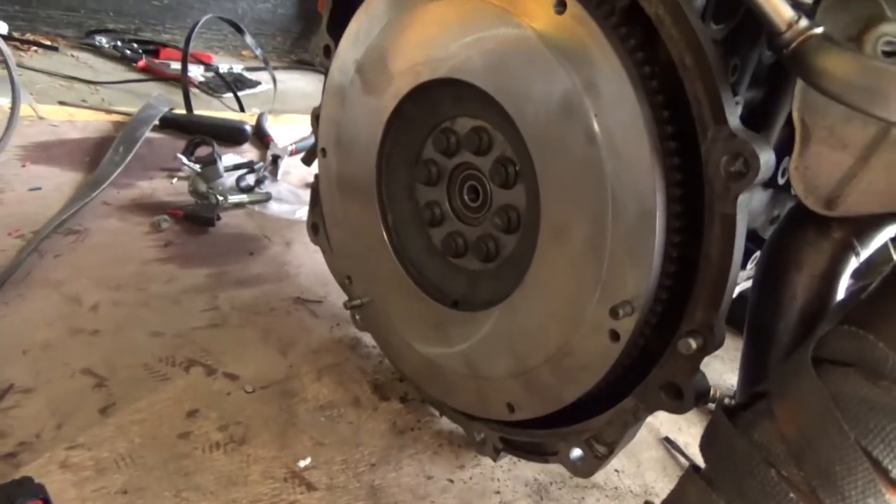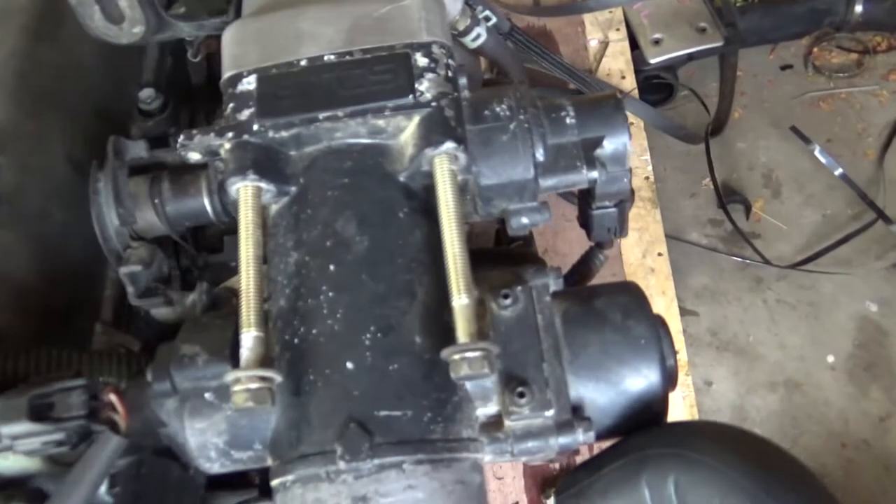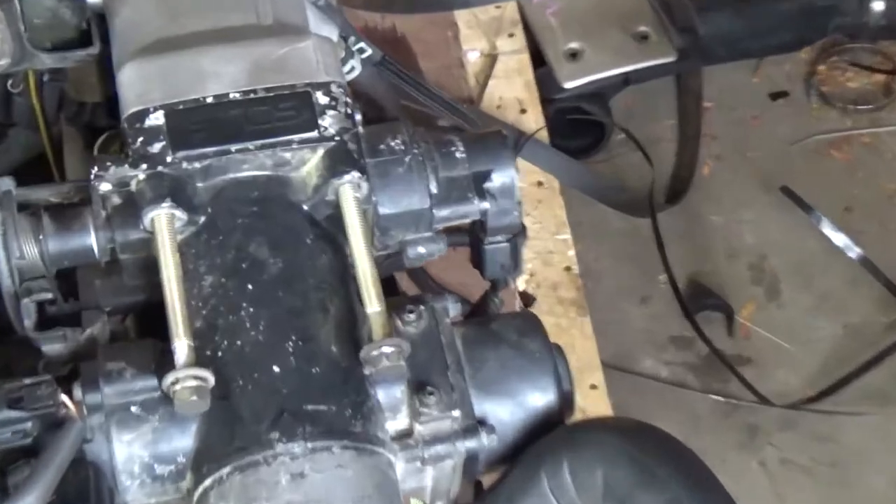I did the flywheel like I showed you. This coolant pipe is bent — I have to bend that back somehow. Also, if you're doing a JZX100 throttle body on a 110 engine, you need the top two bolts — you have to buy some, because they're like a million feet long. But so far everything else is good.